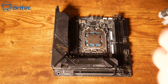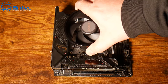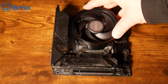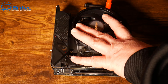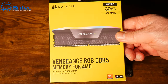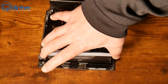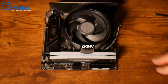I've just removed all of the protective bottom and we're going to use this stock cooler and put it into situ. Don't need to replace the back plate or anything like that - it does come with the CPU itself. It should be adequate for this, but I will want to replace it at some point to try and get cooler temperatures. Let me go ahead and screw this down - it's just four screws and I'm going to go around in a diagonal pattern.